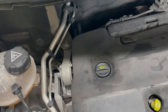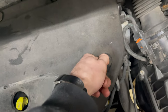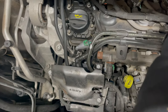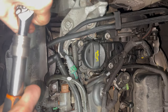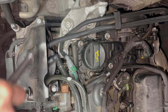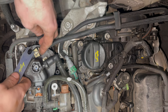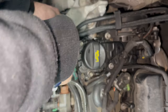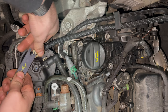Now we can move on to the fuel filter which is hidden by the engine cover. This is the fuel filter under the metal cover — we just need to remove the three 10mm bolts. Now to remove the fuel hoses: they've got these little plastic centres that need lifting up, then the outside part of the clip needs to be pushed down. These were a little worn which is why we were struggling a little bit.